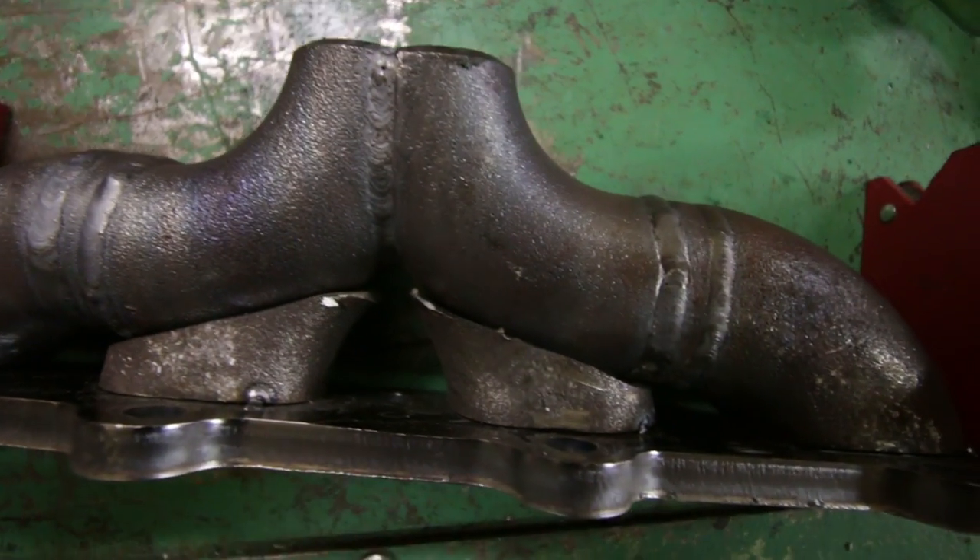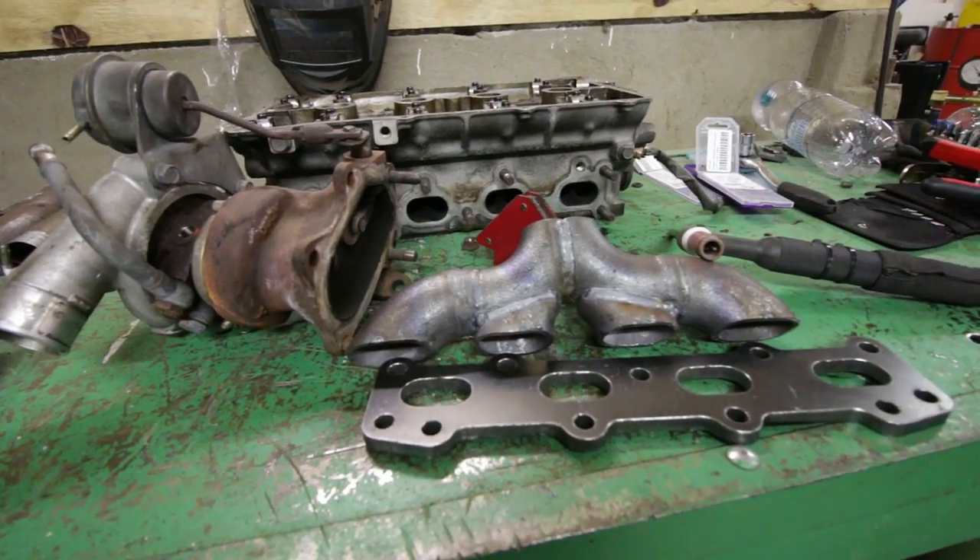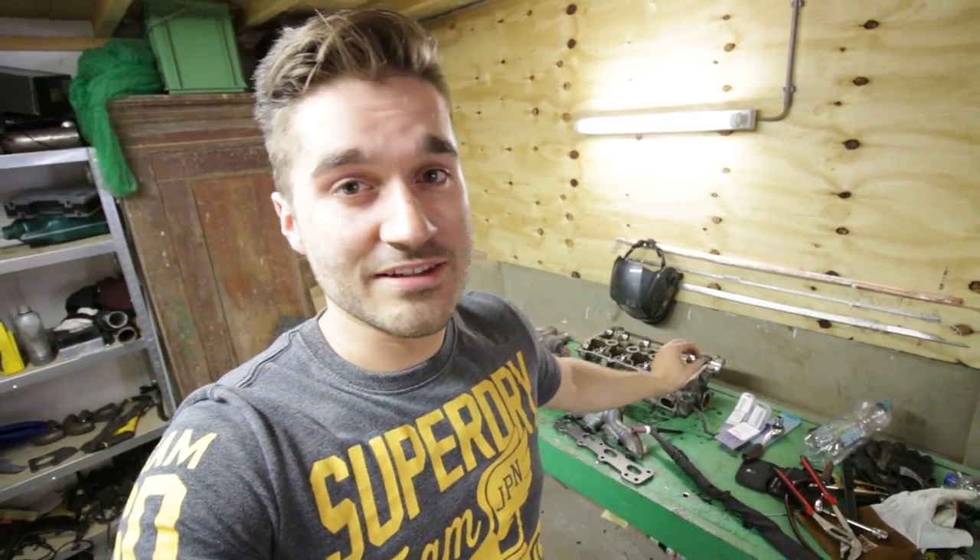The welds look pretty good. The manifold is almost finished — now I need to do some flow management. I need to grind the inside so it's completely smooth with no edges. I want people to get some good power with this manifold. Next time I'm going to do the flow and weld it to the flange — that's why there's a cylinder head here as a heat sink, which should work perfectly. If you liked the video, make sure to give it a thumbs up, share the video, leave a comment below, and of course make sure to subscribe. Bye.